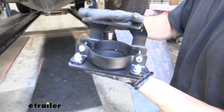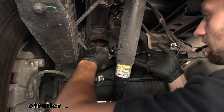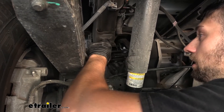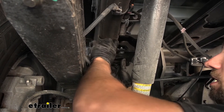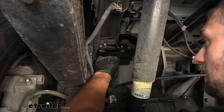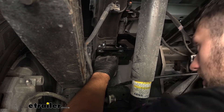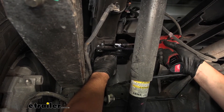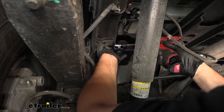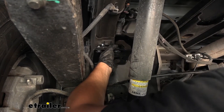Now we're going to take our upper assembly and go ahead and place that on the vehicle over our jounce spring cup — it'll sit right here in this little pocket. We'll come up over the axle and get a 10 millimeter socket ready to tighten this down, slipping it through the cup. We're going to begin tightening down these two black quarter-inch hex bolts, alternating back and forth, making sure we apply upward pressure on the plate this entire time. Once we get it started, the flange nut should catch and we don't have to worry about holding a wrench on the other side.